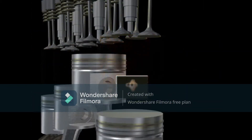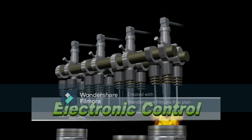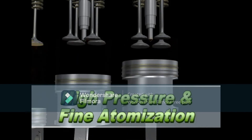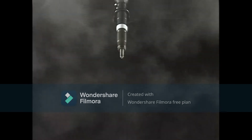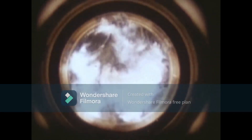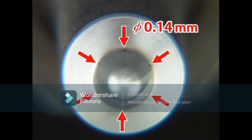In the common rail diesel engine, direct injection delivers fuel directly to the combustion chamber to produce power and minimize heat loss. Electronic control enables the fuel injection system to be operated with ultimate precision. And high pressure and fine atomization injection significantly increase the fuel efficiency. These three important features produce outstanding engine performance. The high pressure and fine atomization injection injects fuel from the injector into the combustion chamber in extremely fine spray, known as fine atomization, enabling easier ignition and more efficient combustion than previous systems.